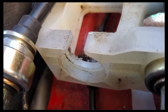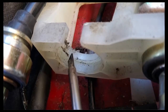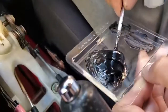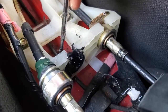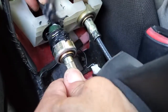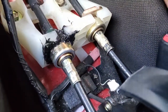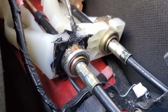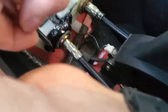At this point I realized that the exact position of the holder was not ideal as it would have a bend when in first and second gear. These are the hardest gears to get into, and I don't want extra stress on the cable, so I used a soldering iron to melt away a bit of the plastic to the left so that the cable can be positioned straight when going into first and second. After positioning and locking in the cable exactly where I needed it, I used some high-strength two-part epoxy to make the holder. I'm planning for this to be mostly permanent, yet it is possible to remove it later with a lot of heat. The cable was covered in two layers — the first focusing on the forward forces, the second for rearward forces. The epoxy was cooled with compressed air and rubbing alcohol to prevent bubbling. This epoxy setup may seem crude but it is now more than strong enough to handle mis-shifts — actually even stronger than the nylon material it is bonded to. The cable is now relocated and neutral is exactly where I want it to be.